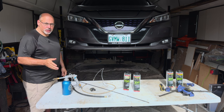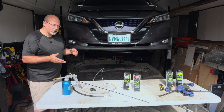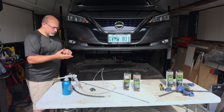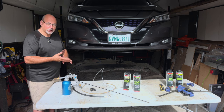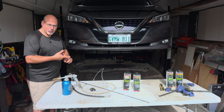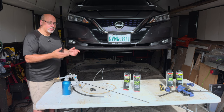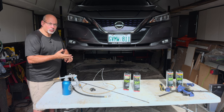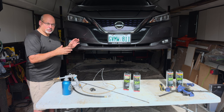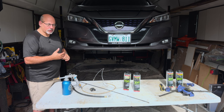Now, tools of the trade. I've used a lot of different products, and corrosion control is a hot topic on the internet. There's fluid film, wool wax — which are lanolin-based products. Here in Canada we see a lot of Rust Check and Crown. I don't use those products anymore. With fluid film and wool wax, they tend to swell up seals, especially lower door seals, and can require replacement of those.